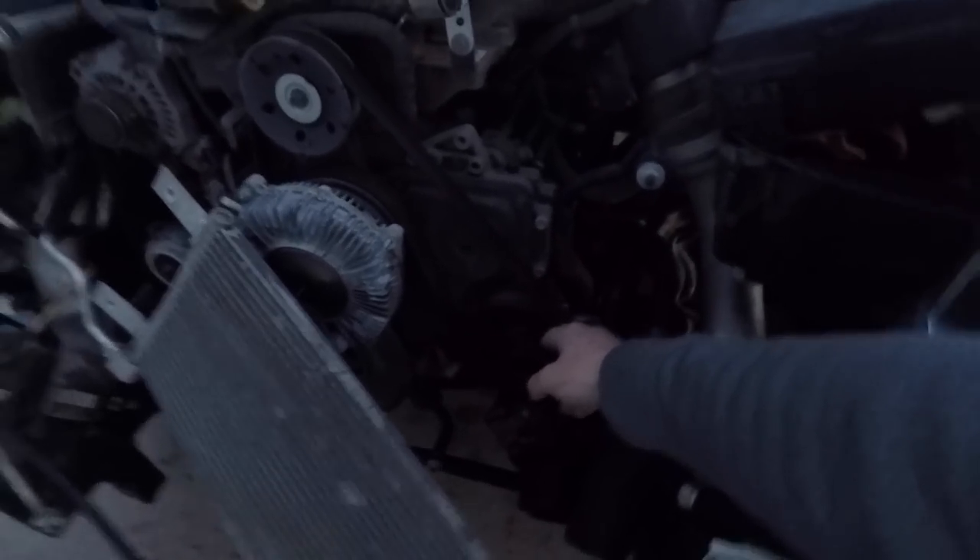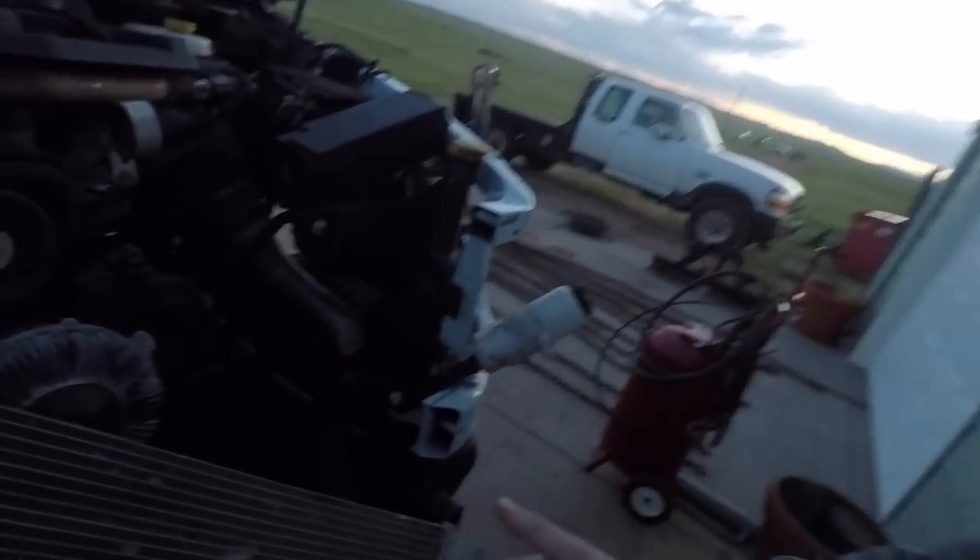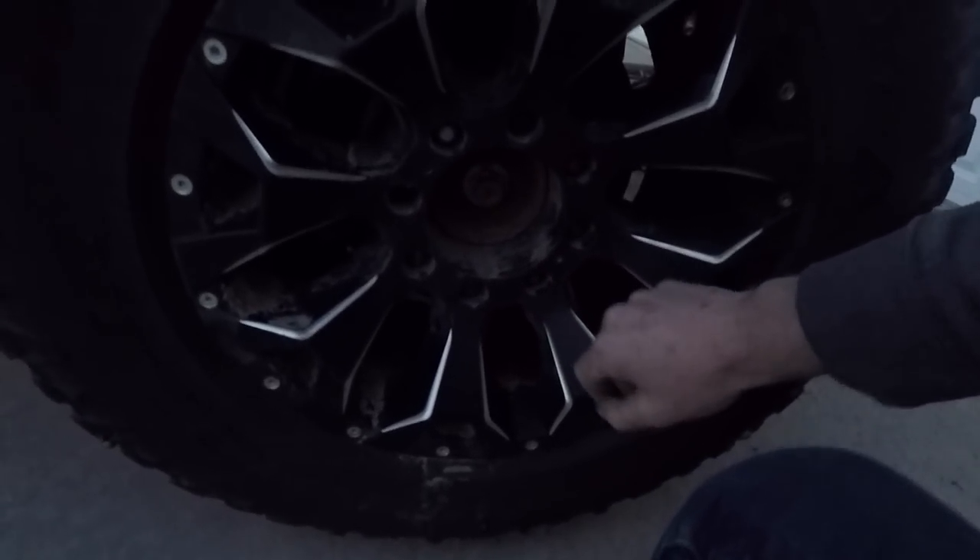I was charging the battery because the alternator on this truck is not charging. I don't know why — the alternator is right here and it does not appear to have been damaged in the accident, but for some reason this truck doesn't charge, so I've got to sort that out. One bolt-on accessory we will replace is the power steering pump. Because of the way the belt is set up, every time the engine is running the power steering pump is running, and because the cooler and reservoir were damaged, this pump didn't have any fluid moving through it. The power steering fluid also lubricates that pump, so it's been running dry with no lubrication — that can't be good. All the hoses that came off, like our radiator hoses, are all getting replaced. I need another cap for the wheel there.